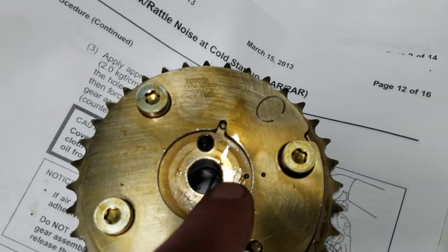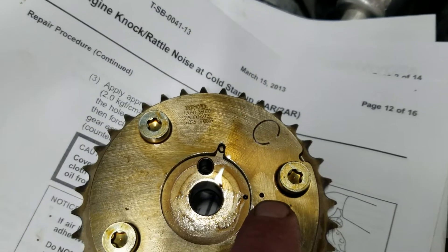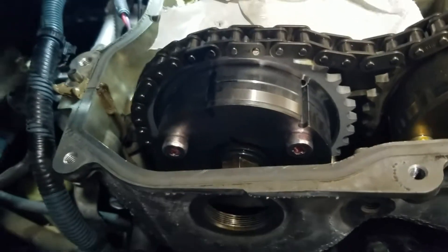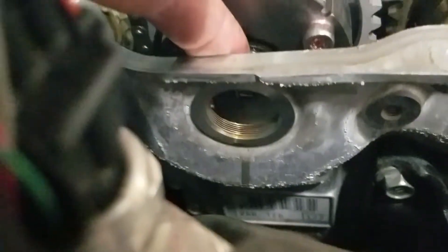This is my old one. When those two dots are aligned, it's locked. When this one is lower than that dot, it's unlocked. I've already installed the new one and accidentally locked it, so it needs to be unlocked before you torque the main cam bolt.